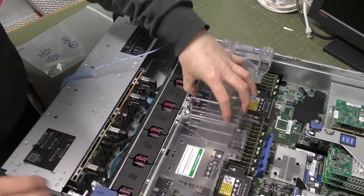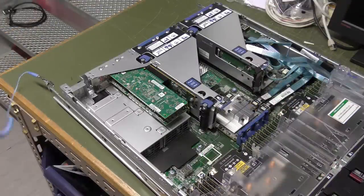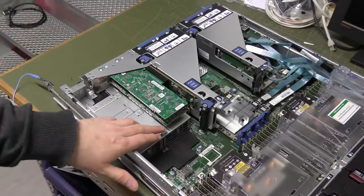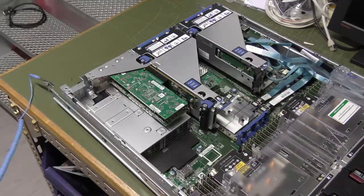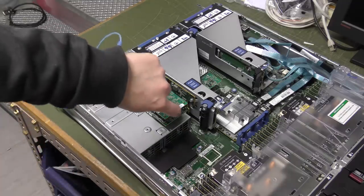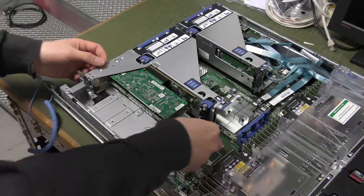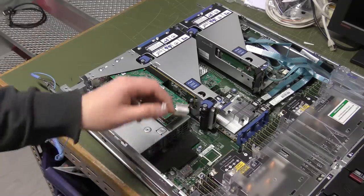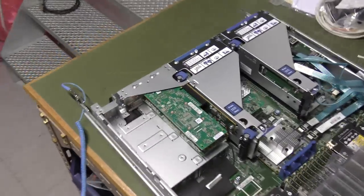And the airflow regulator. There we go. I'm dealing with all the things I forgot — I forgot to connect this RAID controller to the battery. The battery is up here but is powered through the system board. There's a tiny little plug on the end of the card — that little plug goes there.